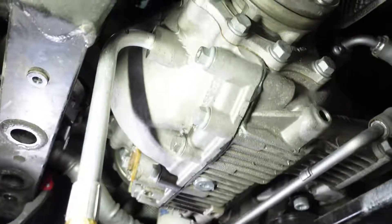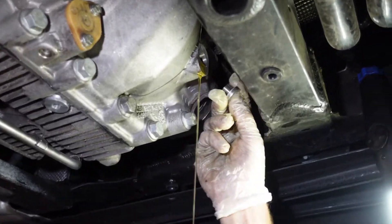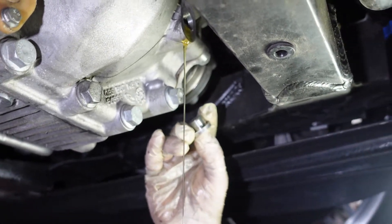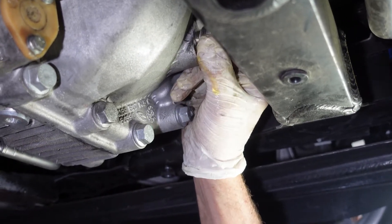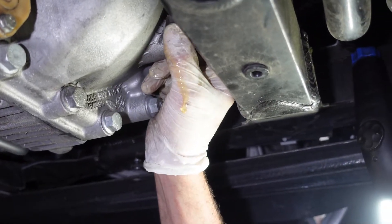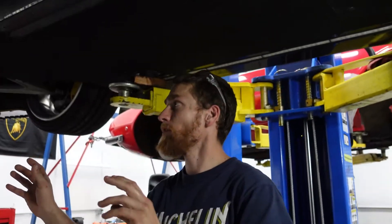Remember, we're always looking for a regular flow — not just a drip. That means it's good. That's pretty much the flow we want, so we know the fluid inside is leveled — a little bit above the leveler. So we can put our filler plug back in. Make sure we always have a new crush washer — we don't want to leak. Those cars are very hard to access; you've got to take out a few thousand bolts to get covers off. We have all the fluids topped up and all the new crush washers on. So we're putting the covers back on now and the car is good to go.